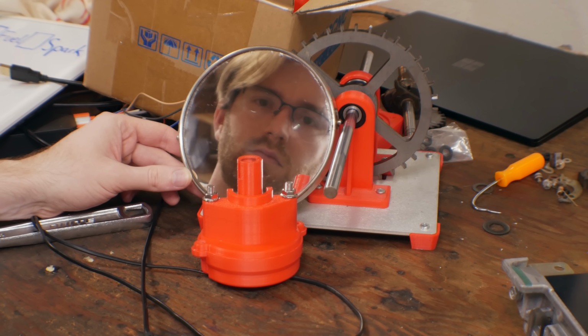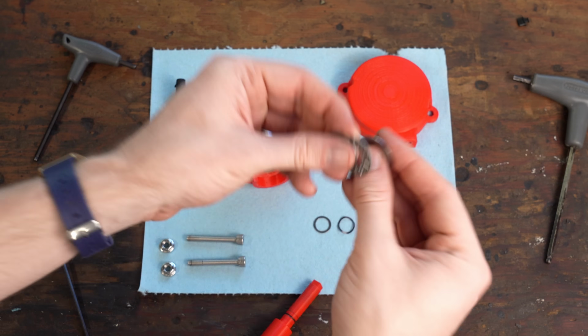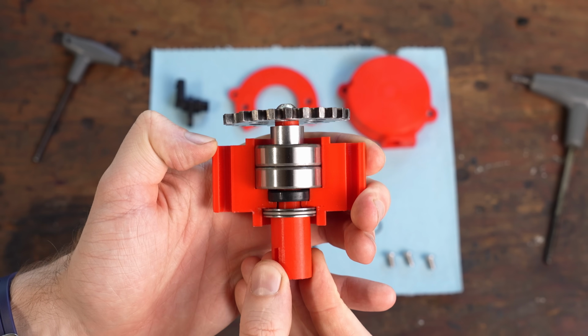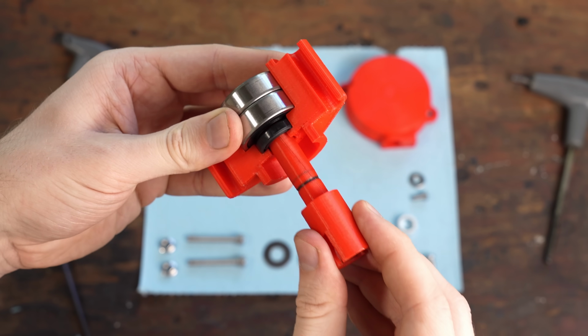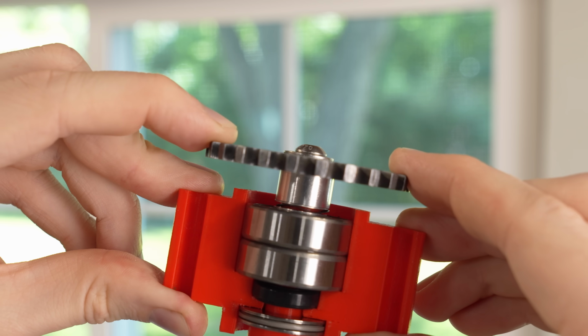It's me. The way I designed this requires there to be a wave washer, which is basically a spring to apply a preload on a thrust bearing. Without the washer, this thing rattles around, and without the thrust bearing, these parts just scrape together, so they both have to be there. However, I completely overlooked the fact that having the trigger wheel directly on a spring makes it so the trigger wheel is directly on a spring. Yeah, give me a day or 2 to figure out this one.